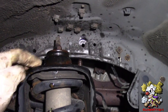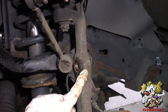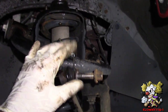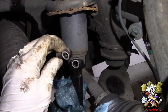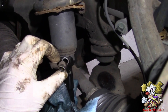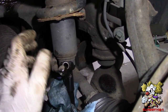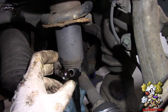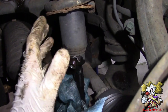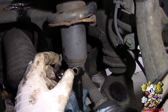There are three nuts up here — take those off. Down here, take the end link off on both sides and just swing the sway bar up; I bungee it up there. And down here, this is the hydraulic suspension I was talking about. What we're going to do — a common thing on this car — is just replace these with regular struts and delete the hydraulic system. I'm just going to cut this rubber hose where it meets the hard line. You're better off doing it this way: less problems, less leaks, less issues, and it's much less expensive. There's nothing wrong with regular shocks and struts.